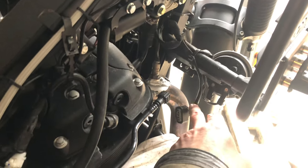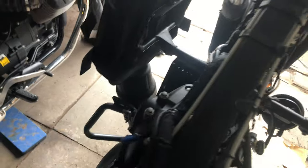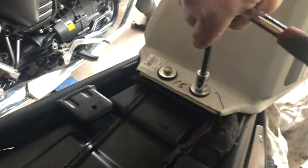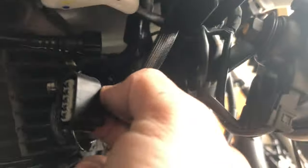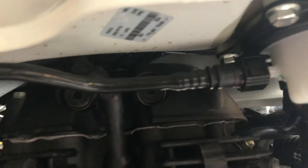It's ready to reinstall the tank. We've got the fuel line and pump cables in position. We've got the two breathers ready to go and the cable to reconnect for the sensor. It's a simple matter now — just throw the two nuts in to hold the tank in place. You don't want to vibrate it loose, but they're not really load-bearing — tight-ish should be absolutely fine. Tank is back on. Reconnect the power supply to the pump and the fuel supply to the pump — the cable just clicks on and should shove easily into place. And that's it — all buttoned up, ready to go.